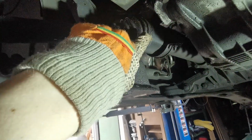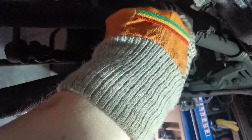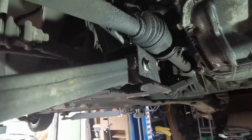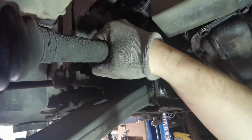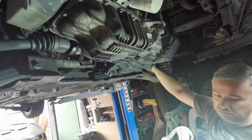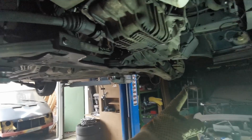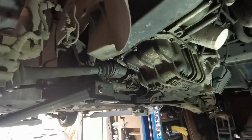Yeah, but primary objective today is this thingy here. Drive shaft. And I don't know if this is just wet because of everything above or because it's shot, but the bearing in there is apparently the one that causes the nice lovely vibrations. We presume that side because it's wet, but might as well be that side. Yeah, we have both, right? Yeah. Okay, so let's get that done.